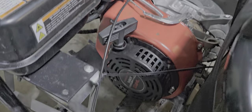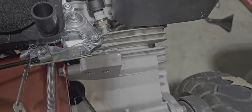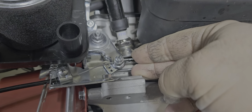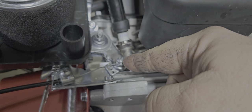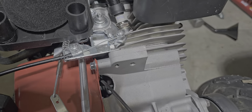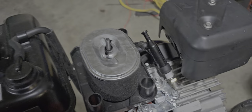your throttle cable is run along the chassis here, up and in. So on this end, you just take some wire snips, cut the end of it off, run it through that part on the Predator motor. And then when you actually depress the gas pedal — there you go. It functions.